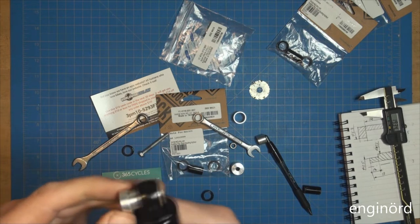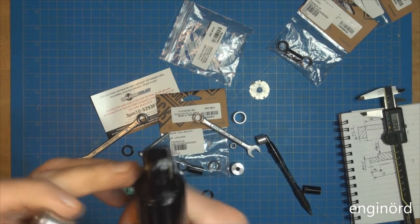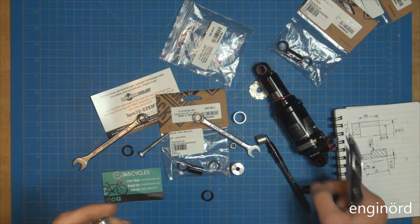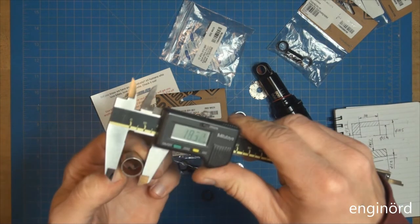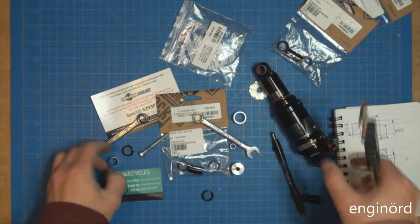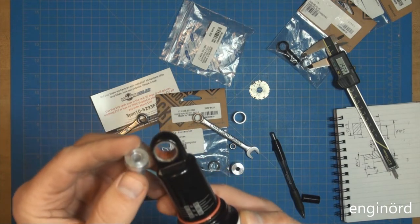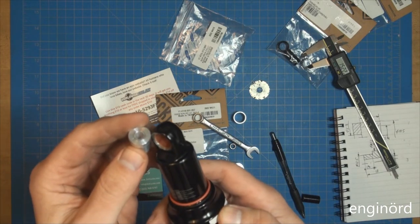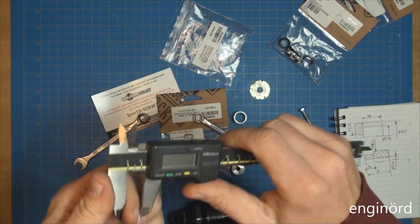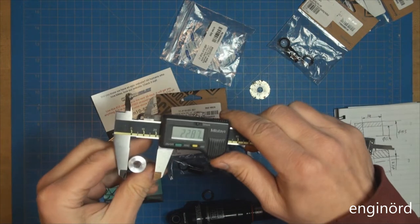So you can see this part, this guy is wedging in, and the size right now is 15.2, and I sized it according to the OD of the bushing. You can see it's 15.2, so it should be less than that, because otherwise it will wedge in. Okay, so I'm gonna go and do some adjustment and try it again. It's a process. Anything you work on is a process. You can get something from your friend and make a copy for yourself.